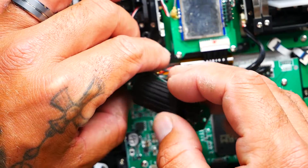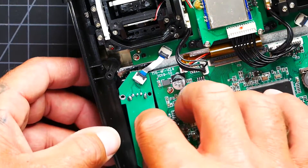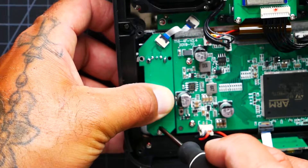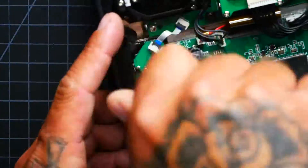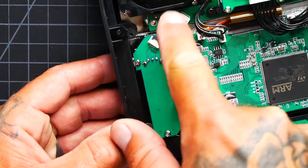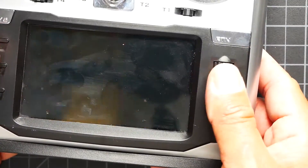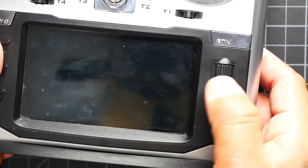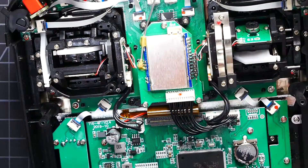It's got to be the board that's malfunctioning — I don't know, but either way I've got a spare wheel now. Just place the wheel on there and drop it in. Take your screws and drop them back in, then use your driver to put the screws back in. After all three screws are back in, double-check your ribbon to make sure it's okay, then flip it over. A couple clicks, a couple slides — and I'm going to be honest, this actually feels a lot better than the other one.